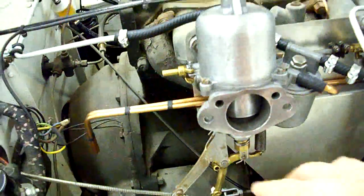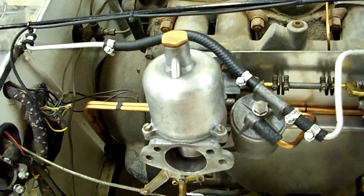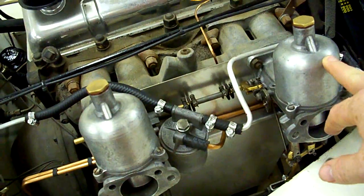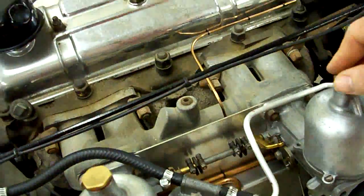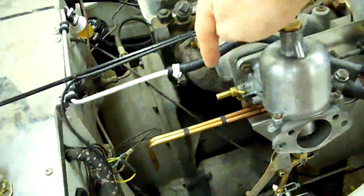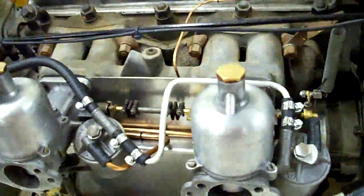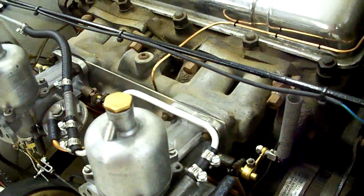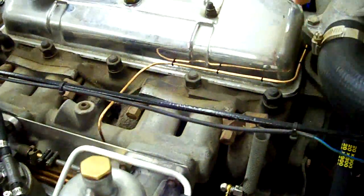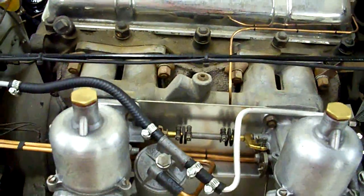All new basic gaskets were needed, along with a lot of fitting. The springs were completely wrong — one was way overly stretched. I replaced the bits that needed replacing: fittings and bushings. The bushings in the throttle shafts were worn out and had to be remachined. Luckily, I have a machine shop at hand, so I could do that at home. I routed a nice piece of rigid tubing. I'm a big advocate of rigid lines where necessary, because over time rubber does what rubber does.